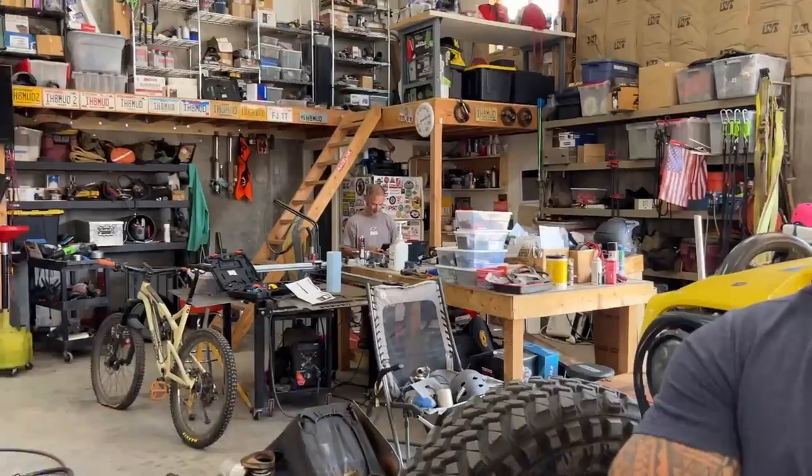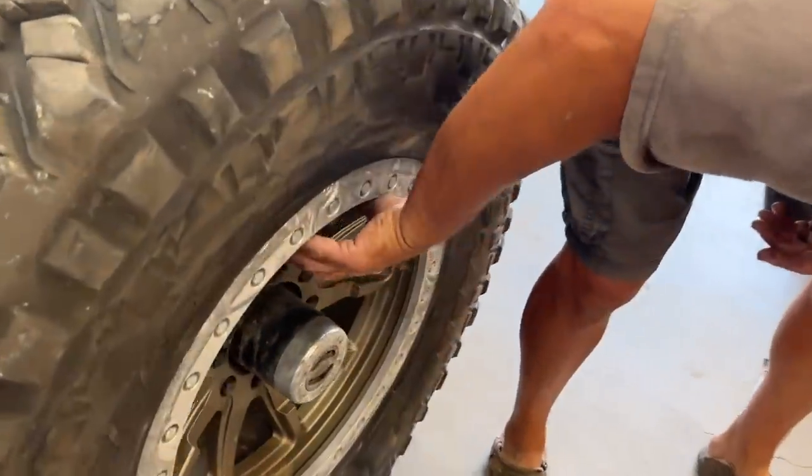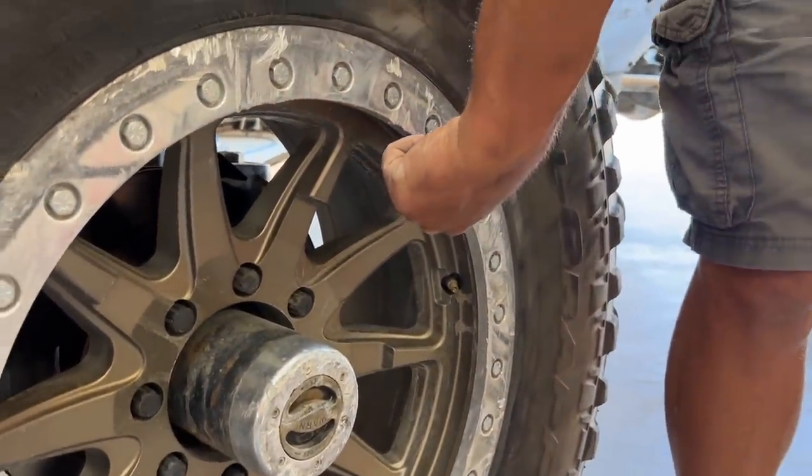When I'm climbing crazy vertical things. 10% of 4,000 is 400. She got it right — 400 pounds. You've got to add 200 pounds to each tire. On my 42s, a normal tire is full at 275 pounds of water. I leave a keyhole up and put my valve stem right there — that's 275 pounds on my 42s. So this one's perfect. We'll just do that one right like that, basically horizontal. Pull the core out, put the adapter on, go flat, start filling, and when you start hearing water flowing through, use a jack stand, pull the hose off and let the water self-settle.